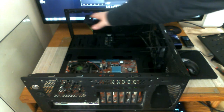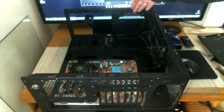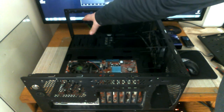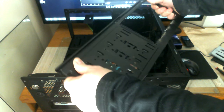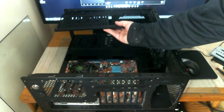Another piece I took out was the drive bay cage and hard drive area. The hard drives were located right here where this fan is — it has a mounting fan mount for 120 and 140 millimeter fans. I took out the wall that normally held the hard drive cages and the five-and-a-quarter bays. I just drilled out the rivets that were holding it in place and removed it.